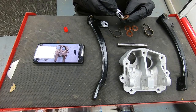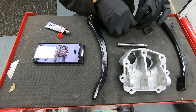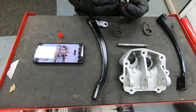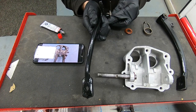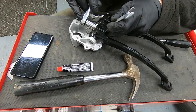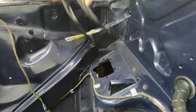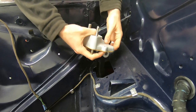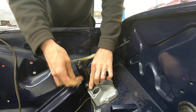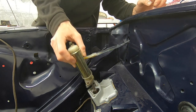When it comes to reassembly, having the photos from when you took it all apart really starts to come in handy and stops you pulling your hair out. I'm using some silicone grease here — it makes reassembly smooth but also helps keep the pedal action smooth too. See that little indent on the bar? That's for the lock bolt. The last bit before the pedal box went in was those studs, which Jaguar handily put UNF on one side and UNC on the other.